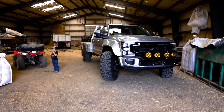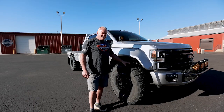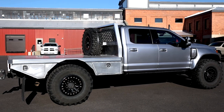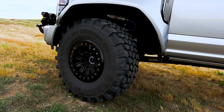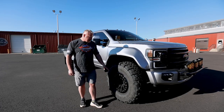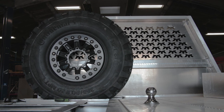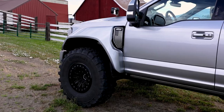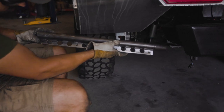This truck also has a much better turning radius than the F350/F250 platform, which was really nice knowing that we were probably going to sacrifice some of that with these tires. Given the design of the package that DBL Designs came up with to go to this Super Single, it was marginal at best — minimal trimming, minimal rubbing only in certain circumstances. But this package he put together was phenomenal. It let us run these 43-inch tires on custom machined 20-inch beadlocks front and back, so we had the same spare tire that would work front or rear because of their machined spacers on the back to get rid of the duals. They also came out with a really nice fiberglass fender extension to give us the coverage we needed to stay legal, and we threw some small mud flaps on it and built some custom ones out back.